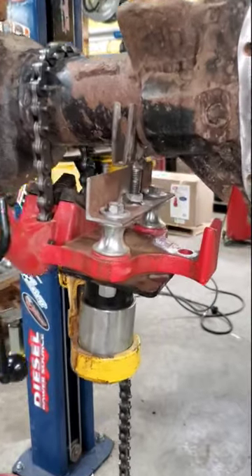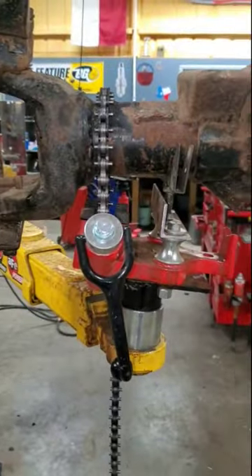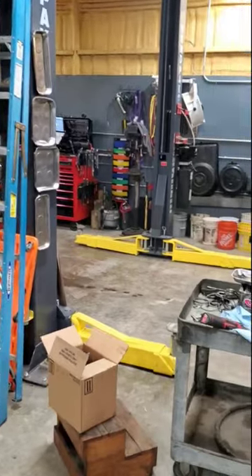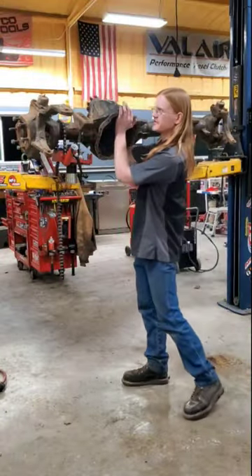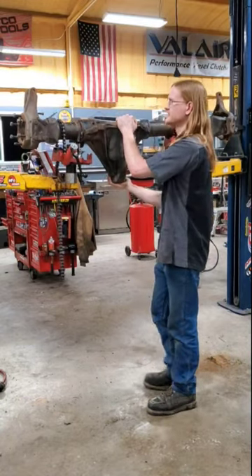This vise has an adjustable exhaust clamp attached to reach up between the center section and the knuckle to saddle the axle tube. Yes, that vise is leaning a little bit, but they're still very sturdy. I made them for the 12,000 pound lift and they fit much better in that one. Now I can raise the axle up to a comfortable working height and I can roll this thing over to whatever angle I want. Pretty cool, huh?